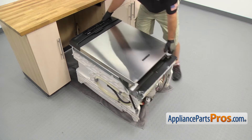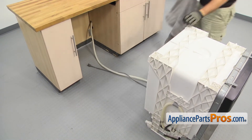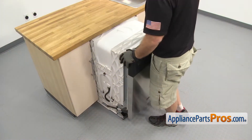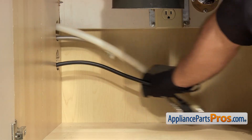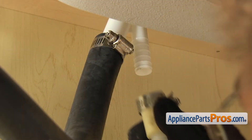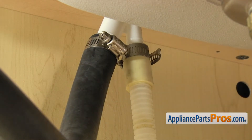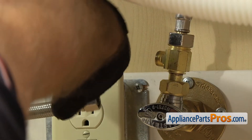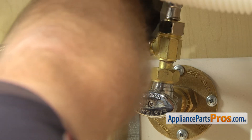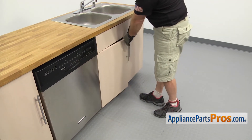Once you have it in place, we can put the dishwasher back up on its feet. Once you have the dishwasher back on its feet, you can pull the towel out. Now we have to reach underneath and put the lines through the cabinets. We want to push the dishwasher in about halfway, then we can go underneath the sink and pull on the lines to make sure they're not caught on anything, and then push the dishwasher in the rest of the way. Now we can reconnect the drain hose to the air gap. Once you have it pushed up into place, we're going to use our 5/16 inch nut driver to tighten down the clamp. Once you have the drain line hooked up, we can hook up the water line. All you have to do is get it started by hand. Once you have it snug, we can reach in with our 5/8 inch wrench to tighten it down so it doesn't leak.